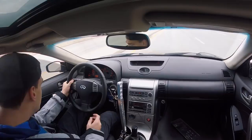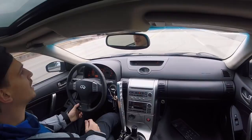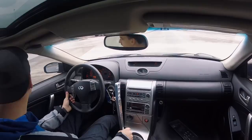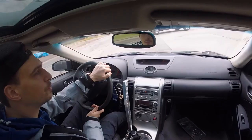Welded diffs aren't that scary. Maybe a little bit when you're first starting out and don't know what to expect, but as long as you have a good understanding of what you're doing — you know where your tires are, how much gas you're giving it — it shouldn't be an issue. I'm gonna take a right here just to show you guys some tighter corners and show you that it's okay to drive a welded diff.